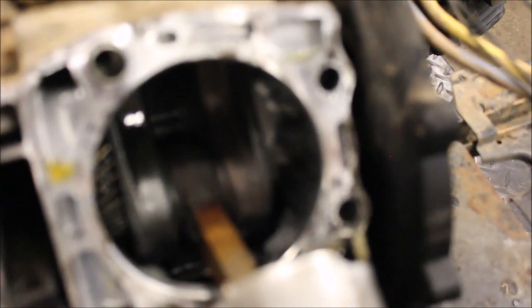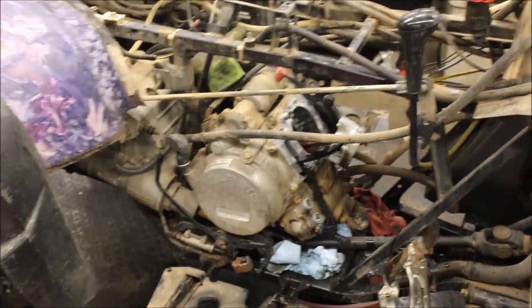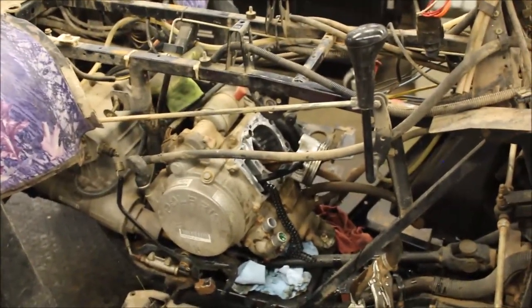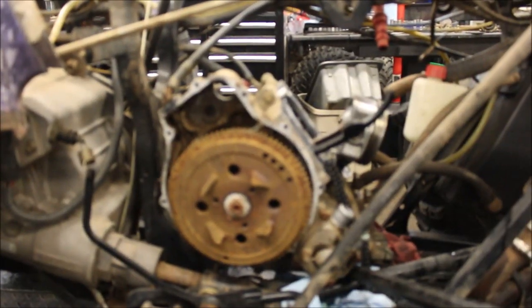See how it's all burnt down here — this is stiff, it won't even turn. Connecting rod bearings are toast. I could just get away with putting a new crankshaft in, but I do have a bunch of bottom ends. If you've been watching my channel, you know I like to take 425s and convert them into a 500 — I think they're a little snappier. That's just my preference.